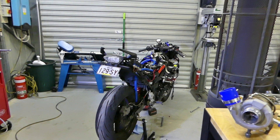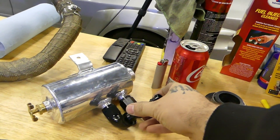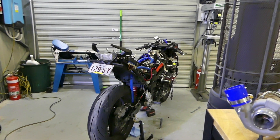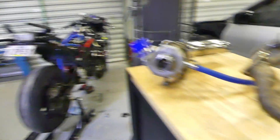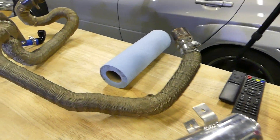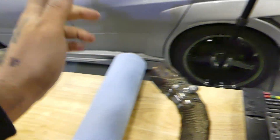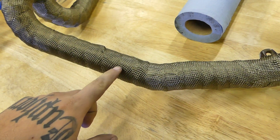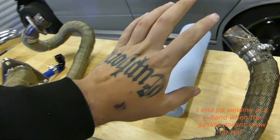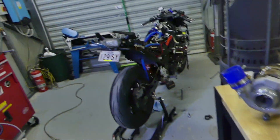And then obviously if you go over bumps and stuff, it doesn't stay in the can. So I'll set you up. I'm going to have a fiddle around and see where I can locate this thing — trim and chop a few things up because I got both of these to line up. I only got one chance to line it up as well because there's not enough of that hose — I think it's like three-eighths hose — there's not enough to do it twice. So one shot. I was actually thinking today I could just run a bead through here, welding it to that, but I've wrapped it and I don't want to unwrap it to weld in a V-band. So I'm waiting for the gasket — it's the easiest, most serviceable way to do it. I'm just going to leave it.